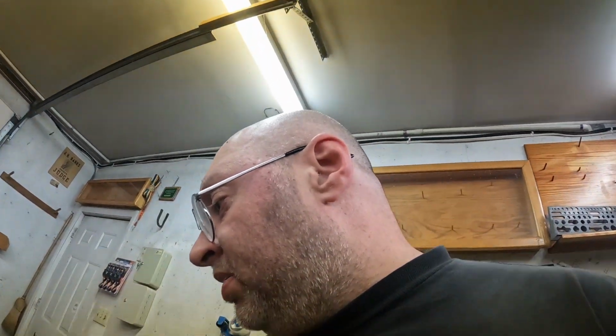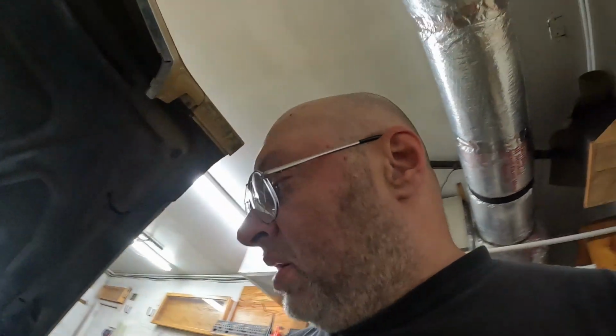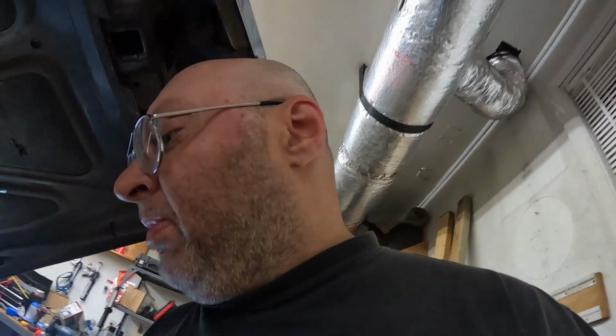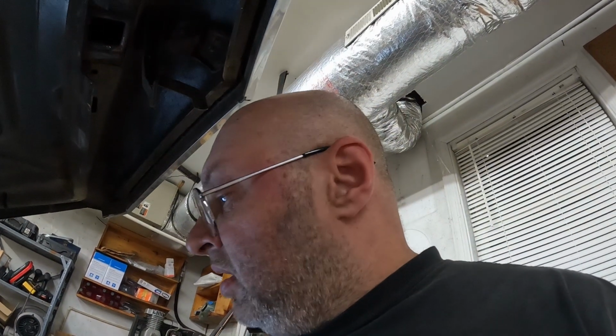But you know, everything else, I pushed fluid through it. The only place it was leaking was right there. So it looks like all my lines I made were good. And I may go ahead and do the whole line now that I'm just kind of aggravated with it. Or I may just flare it and put it back together. I've not really made up my mind yet. But I'll take that with me tomorrow and get the piece I need.